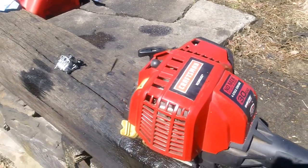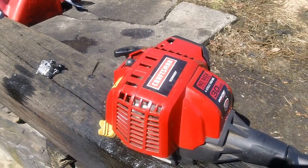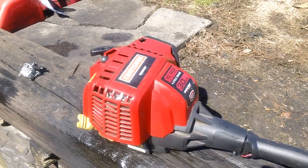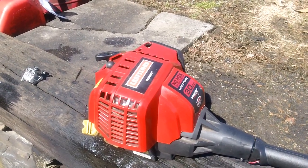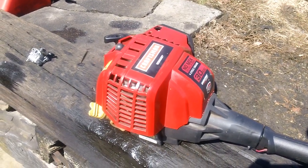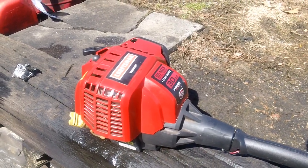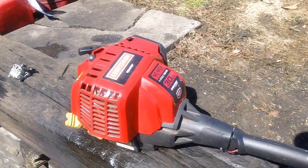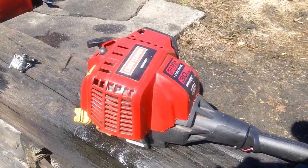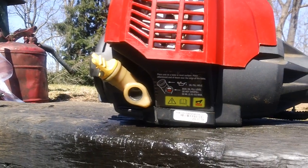That's one reason why a lot of people like this specific model. I've had probably about five or six of these over here last year. People liked them because it was a lot easier to pull over as opposed to your typical two-stroke, like a Husqvarna. A contributing factor is also that they don't have to mix the gas with the oil — if they do it improperly it might burn the engine up — so you simply just put gasoline into the gas tank.